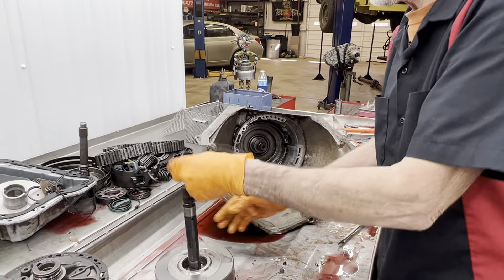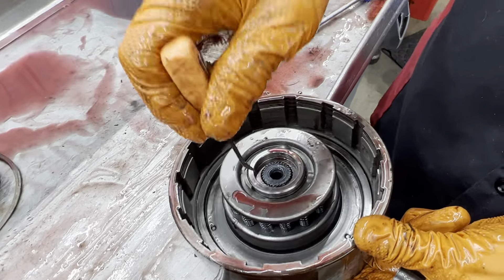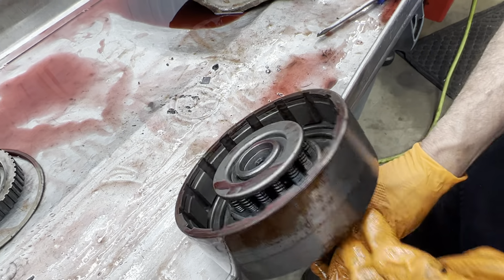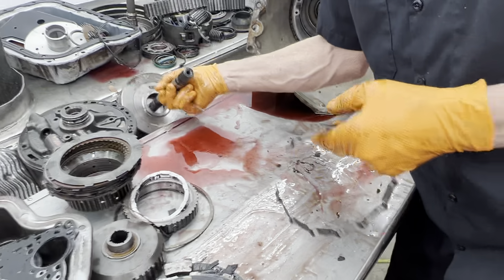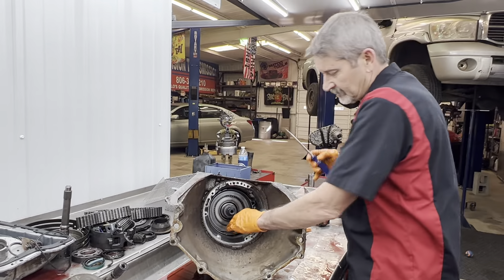You want to look in here and make sure there's no funny wear right here where this roller runs. Now this piston right here — there's going to be two seals on the piston, one seal in the drum. We will be leaving that seal out so that it uses the whole surface area of the piston to apply the clutch instead of just using a partial of the piston. Anytime we get more surface area to push on a clutch, the clamping is a lot better. Same way with the forward drum — it's got two or three seals and we'll be leaving one off too so it covers the whole piston to apply the clutching in first gear in the forward range.